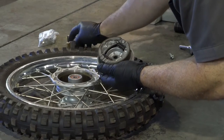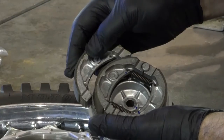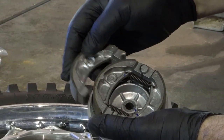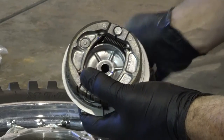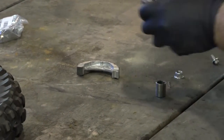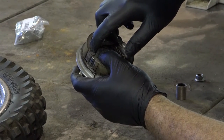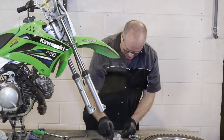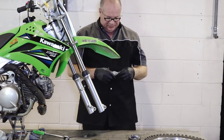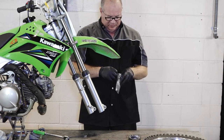As I told you in the beginning, these pads are hardly worn at all. You can look at the difference between a brand new pair and this — they may have been worn maybe 10% of the way through, so there was still a lot of life left in these. However, if you pulled it apart and this surface area was not there, it was all the way down to the metal, well then they need to be replaced. But I'm still going to go through the motions and install these new ones so you'll be able to do so.